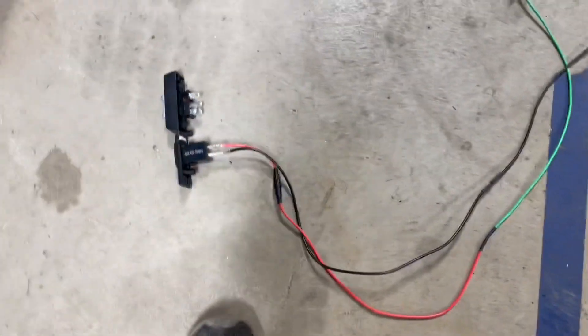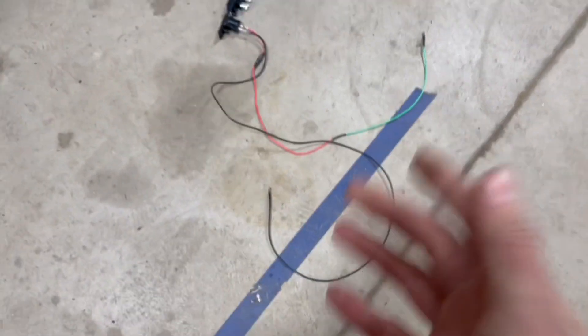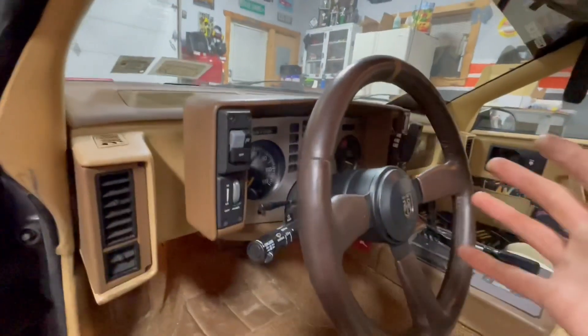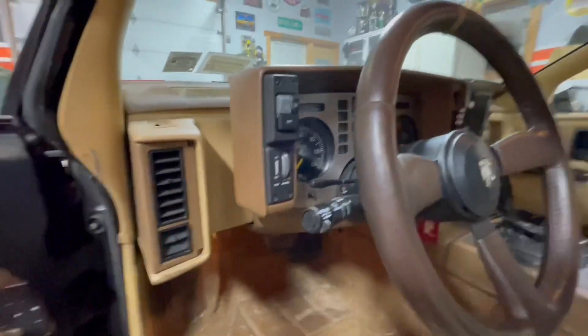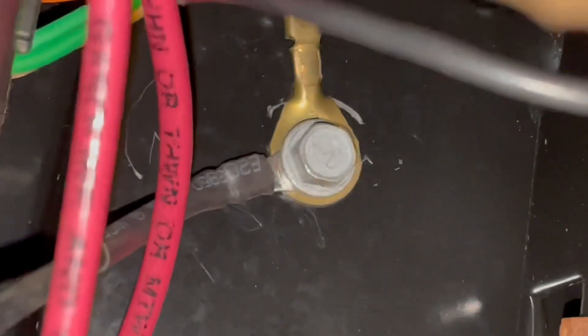Here it is all put together. I did make another adjustment — I found the ground I'm going to use, so I put a small ring terminal on here, and now we should be all good to throw it in the car. I just hooked the battery back up. I have this still loose, and I have the wire still dangling down here. I just want to see if this works — I haven't tried it yet. For the positive, I have it going down into the ignition slot on the fuse box, so it should only turn on with the ignition on, and for the ground I have that up under there.